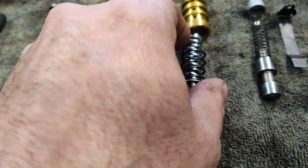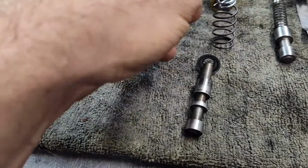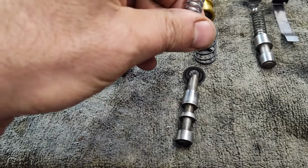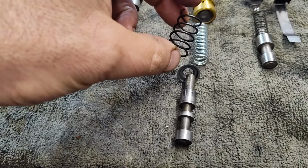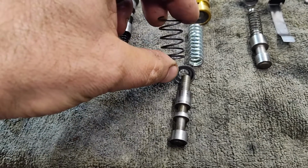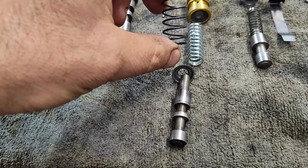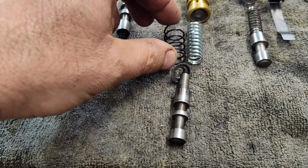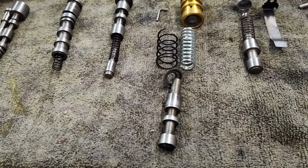Your pressure regulator is pretty simple. You don't have to really do much there. You get this spring in the kit. It's a heavy gauge silver spring. And the original outer spring, I tell you, you can leave it long, you can not put it in at all, or cut it. I've chosen to cut it for this application. That's just going to give you different pressures, and the instructions explain that.